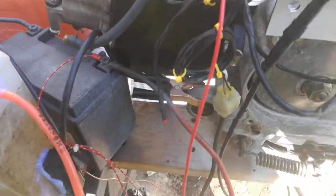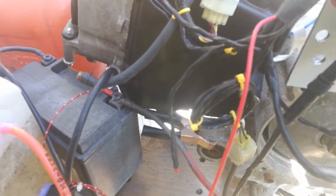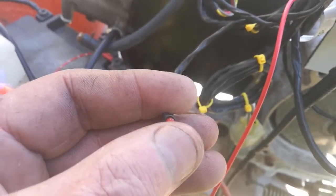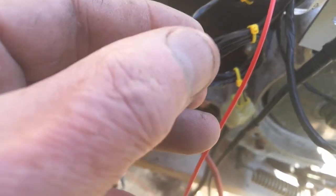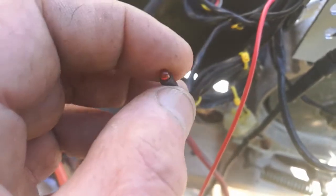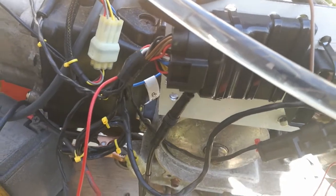As I said, the O2 sensor isn't connected so it's running very very rich and a bit lumpy. I reset all these settings back to as I got the unit — I tweaked a couple for better running but thought it'd be best to show you exactly as it came. There is an LED which Bruno from Moto EFI added for me because I wanted an engine management light. At the moment it's showing the ECU test. The LED comes on during the same period of time as the pump runs. The main EFI pump, then when you crank it, it flashes to show you that you've got a signal input from the timing sensor. Anyway, it's now running.